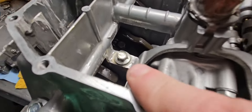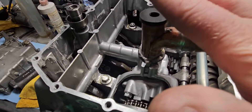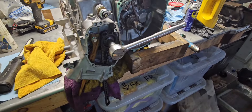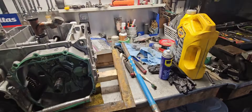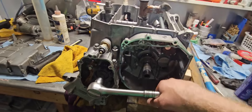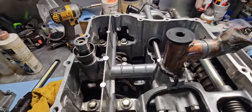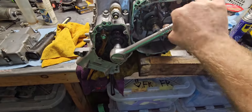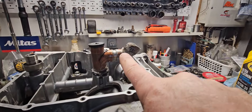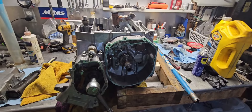I had recommendations to take off the oil pan, which I did, and put oil down all four bores basically up to the cylinder. Then my buddy Sean told me to heat the outside, and I took the snipe out — I didn't go too crazy on it, I think it's an M10 bolt. Things turn now — happy days! I'm going to put the oil pan back together. If you know what this is for, you know. Good news — it's free.